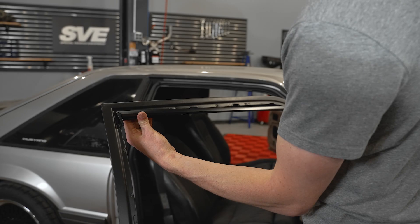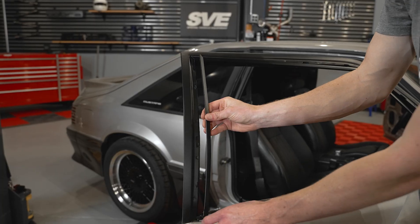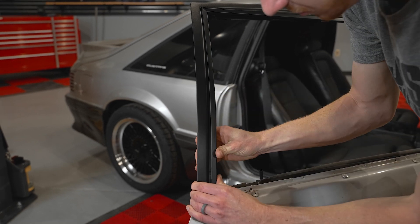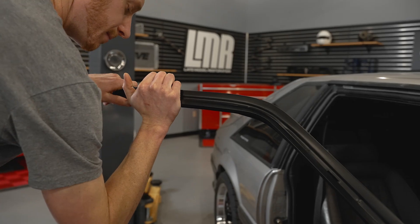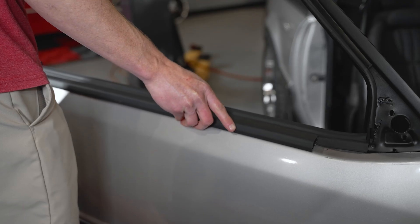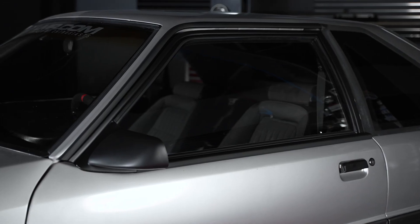Now we can install our new 5.0 Resto run channel trims. Start with the boomerang section first and align the trim with the rearward corner of the door frame. Gently push this section onto the door frame so that it holds itself in position. Next, take the vertical section and slide the 45-degree end into the L bracket. If needed, adjust the large section accordingly. Once you have it situated the way you like, fully seat the vertical section by pushing the trim onto the door frame. Go ahead and fully seat the large section by working your way across the top of the door frame. Now that the run channel trims are in place, you can install the run channel weather strip, outer door belt weather strip, outer door belt molding, mirror, and the roof rail molding. After that, reinstall the door panel and associated door components. Repeat these steps for the other side and you're good to go.